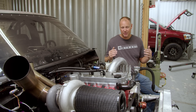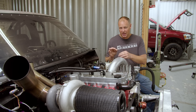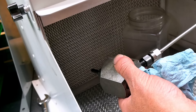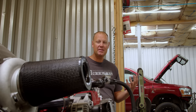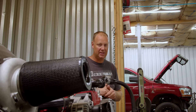When I got the valve cover off in the shop, I noticed an even bigger problem. The exhaust rocker arm was broken - not the rocker arm itself, but the little steel piece that connects the rocker arm to the valve bridge. That piece was busted off. I decided I'd replace the injectors anyway, replace that rocker arm, and hopefully everything would be good to go. But as I was going through setting lash, I found an even bigger problem - I have a broken lifter. That's a pretty deep fix. I'm thinking there's no way I'm hitting this race.